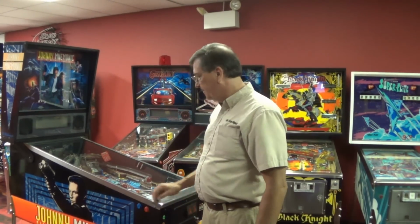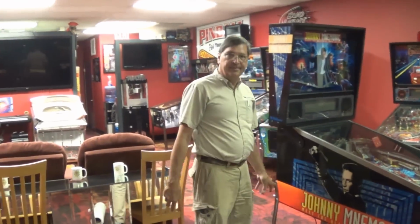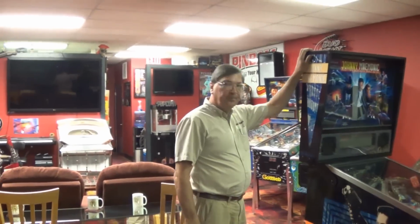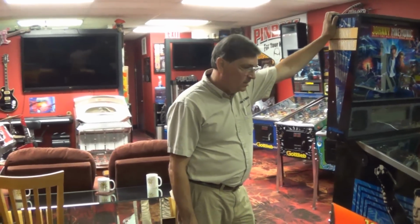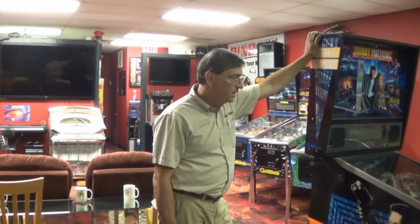Yes. Okay. Sweet. All right, we got a WPC here. What's different? We're not taking the legs off of this, but the rest of it we can do. Yeah, the legs are the same as on the old machine. Okay. So same setup. You're going to take the balls out. You're going to take the glass out. You're going to check the inside, make sure there's no crap floating around in there. Correct. You're going to put the playfield back down. You're going to put the glass back in, the lockdown bar back on, door shut.